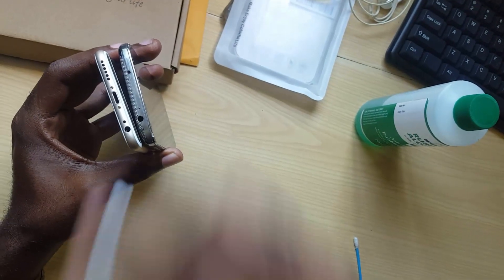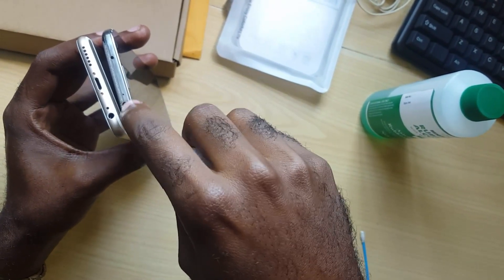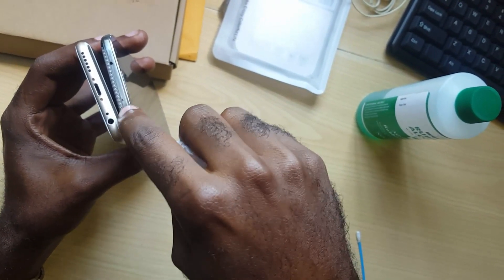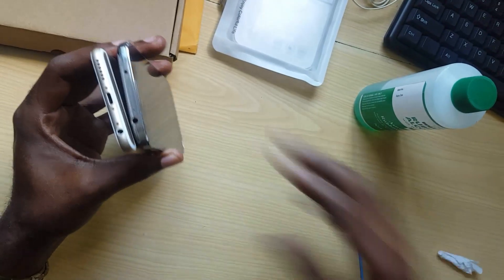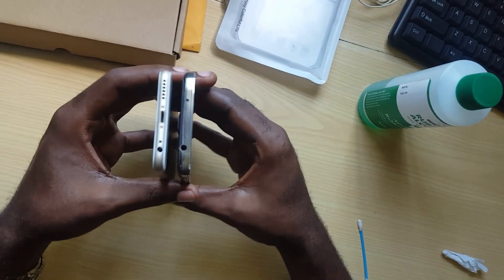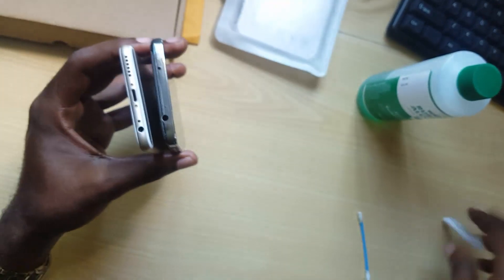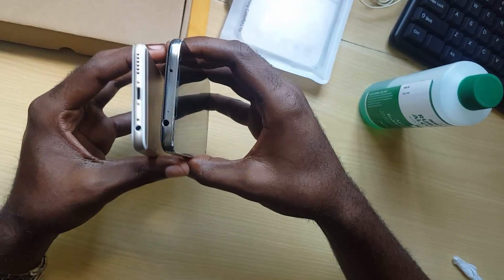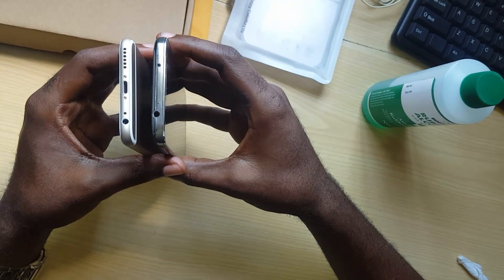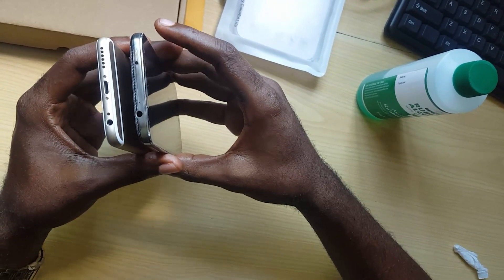After a while the audio will actually come back on, and you'll see that the headphone connected error does disappear and your phone will behave as normal. Just take the time, use cotton — I've found bathroom paper works just fine. You can also blow into the ports, and if it doesn't work the first time you can repeat this up to two or three times before you get the results. Be patient.